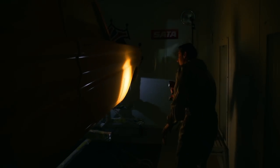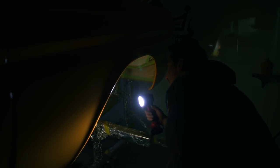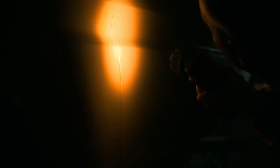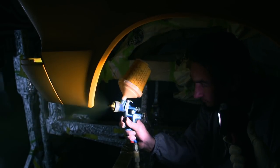Now for the bottoms and edges — I see one. Right here in the corner, there's just this little dark spot. When you're coming up to an edge with the paint gun, the material that's coming out — if it doesn't have anywhere to flow on that edge — it'll tend to build up, so you're basically stacking more layers of base at that point, which makes the edge look a lot darker than the rest of it.